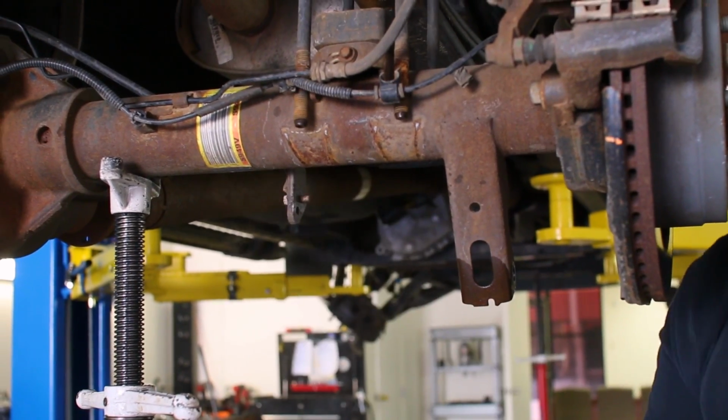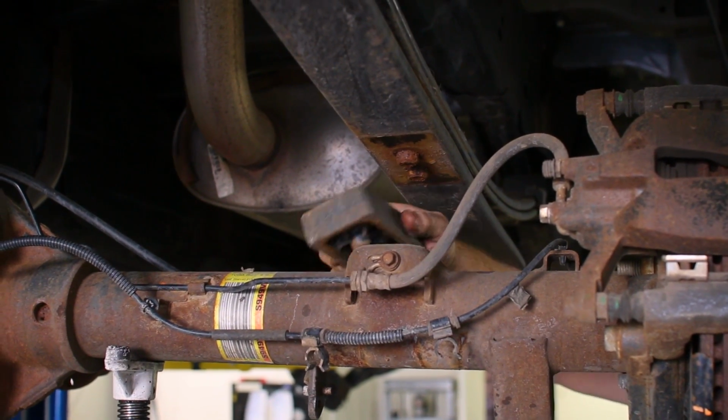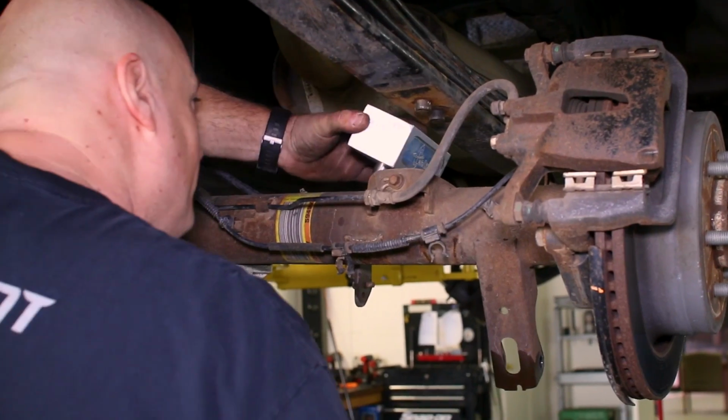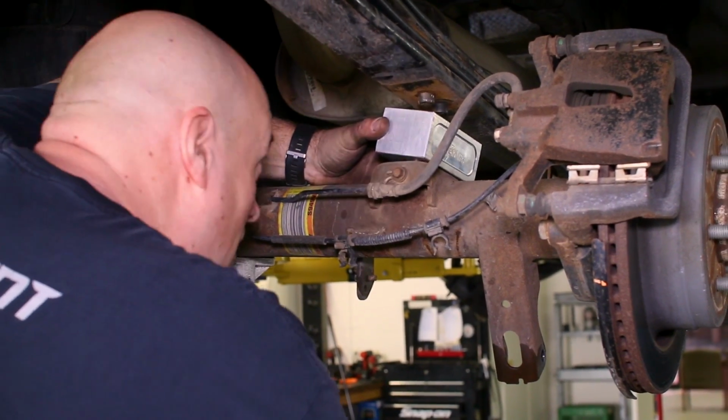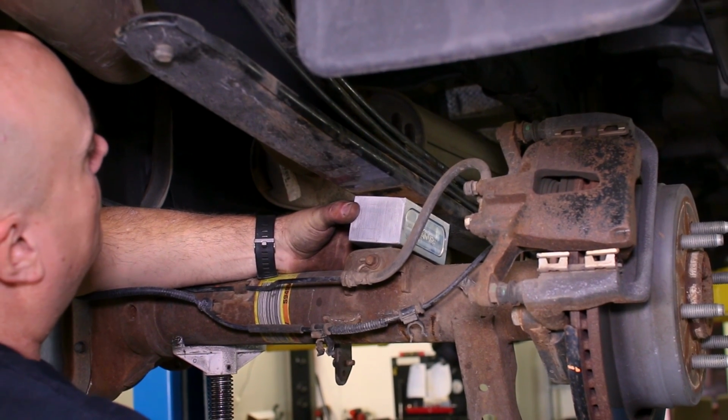Once you lower the rear end down with your jack, you can remove the U-bolts and stock rear block from the truck. Replace the block with your new part from Halo Lifts and be sure to align the pins into the axle and leaf pack for proper alignment when raising up the rear end.